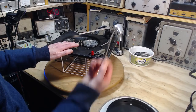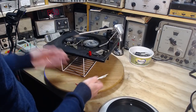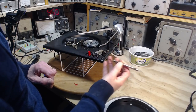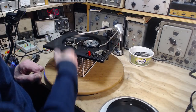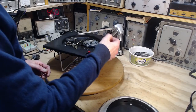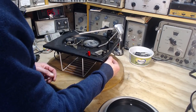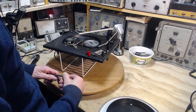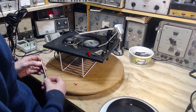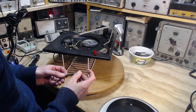The spindle — a record-dropping spindle — was missing on this record player until they took their record player out and found the spindle inside the console underneath the record player. I think that happens a lot because they just fall to the side of the record player, and if they manage to roll just a few inches inward, they'll fall through a hole and go inside the box. And the result is this can go missing — a little hard for your average person to get into that box.